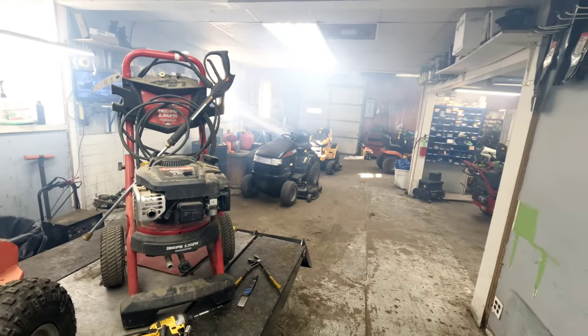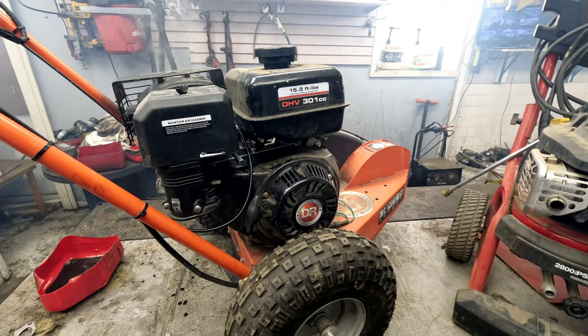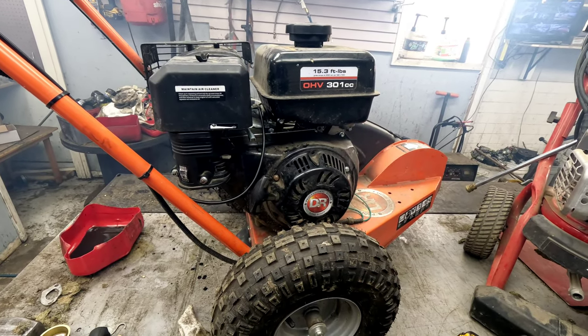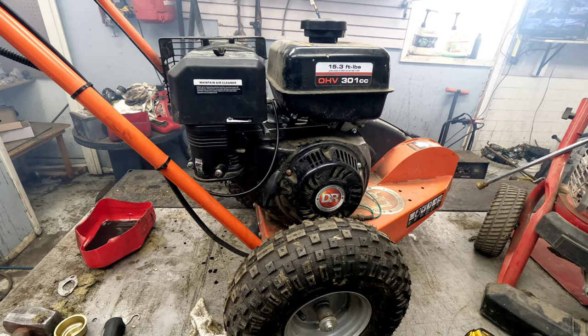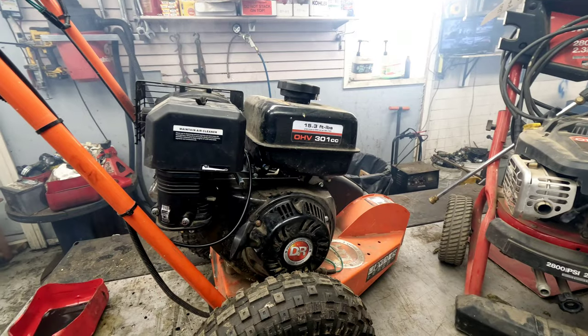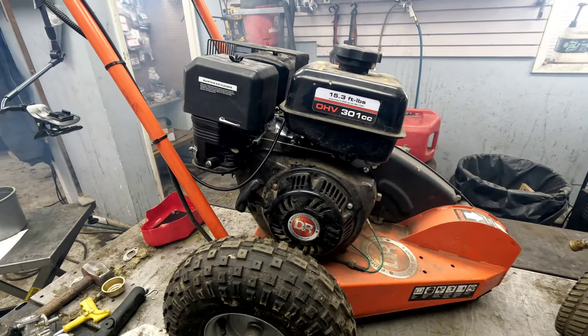It's kind of crazy, but that should get your DR stump grinder back up and going, or any Honda clone engine like this. Should take care of all the issues you need with a new carb. And with the handle in the way, it adds kind of a twist, but nothing you can't overcome with a little bit of ingenuity. So thanks for watching.